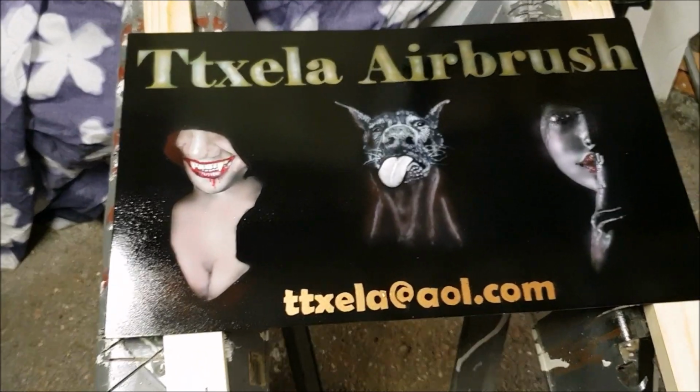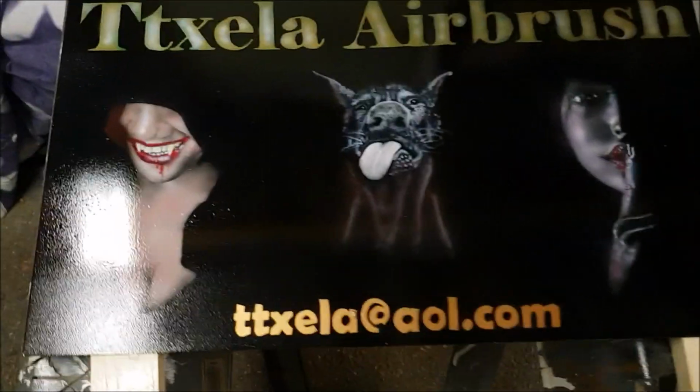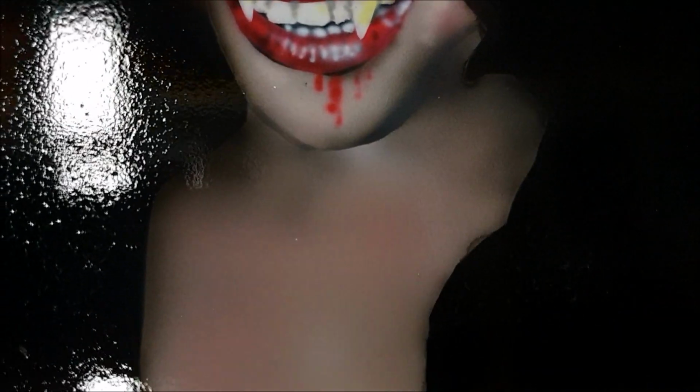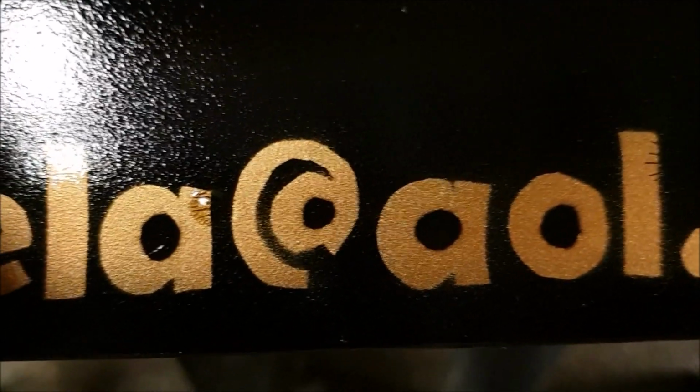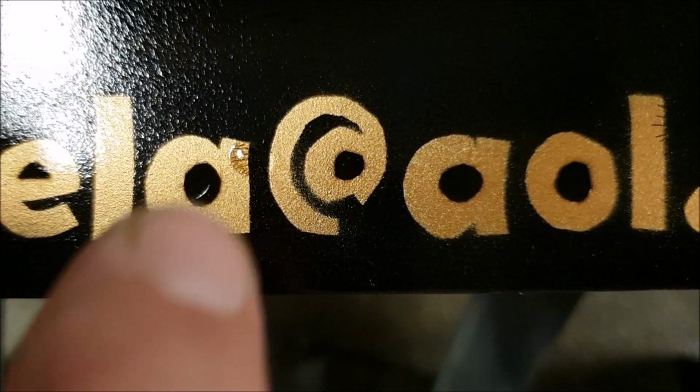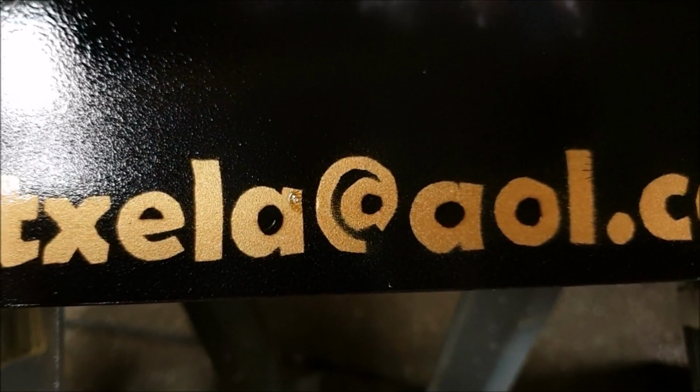Well, I'm not entirely sure about this really. You can see there is quite a heavy orange peel, and up here I'm not sure really, but I think it may have started crazing slightly. Anyway, we're going to have to give it a good rub down, I think, once it's hardened off. You can probably just about see on the edge of this is where that blob is from when that ran out.